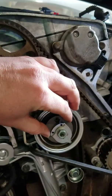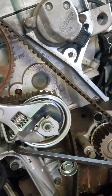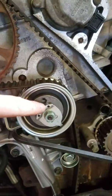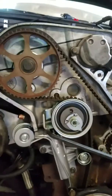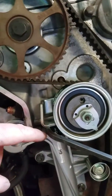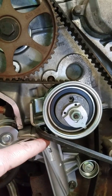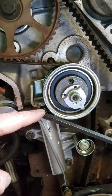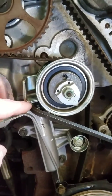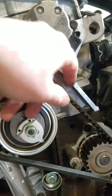When it comes to setting the eccentric pulley, you can buy the special tool that fits in these two holes. You can also use a crescent wrench and just grab on the side and rotate it — it's quite easy. I don't even know why they bother with a separate tool because the crescent wrench works perfectly. You can also use needle nose pliers if you want to stick them in from the front, but I think the crescent wrench gets better leverage. What you're trying to accomplish when setting the tension is to set the gap between the tensioner and the lever on the eccentric pulley. The spec is between 6 and 10 millimeters of gap once you release the hydraulic damper on the pulley. I just have an 8mm Allen key in there and as you rotate this indicator counterclockwise, it will get tighter and tighter on the key and pull the belt tighter and tighter.